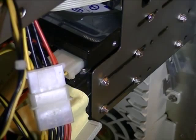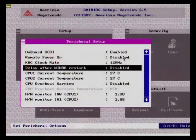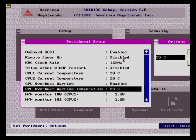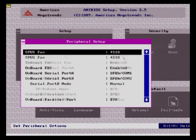When the machine starts things don't seem out of the ordinary besides that SCSI LED. The SCSI hard drives then start up — and that's when you know this machine is serious. Those discs spin at 10,000 RPM; you can imagine what a large number of drives with staggered spin-up might sound like. This was one of the last motherboards I saw which used AMI WinBIOS — quite a shame because I rather liked it. It was also one of the first boards I know of to have temperature and voltage monitoring that actually meant something, and you can see here that the motherboard has overheat protection.